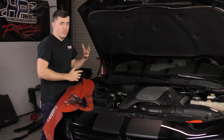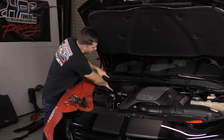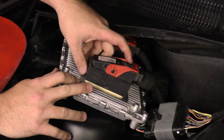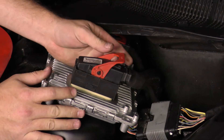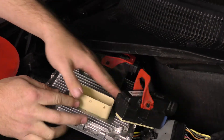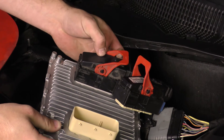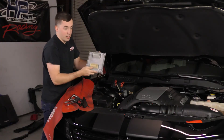Now we're on the final step to remove the PCM from this vehicle. We're going to pull it out and take these clips off. There's a red lever that you have to press the release tab for and then pull the red lever up. Once it's there, you can just finagle the plug off the computer. There's one on the top and one on the bottom, and not having that bar there has given me the ability to pull this computer essentially all the way out of the car.